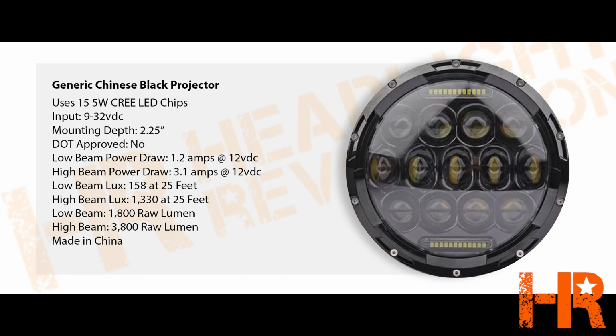It uses 15 5-watt Cree LED chips. This headlight has a 9 to 32 volt DC input rating and a mounting depth of only 2.25 inches. This headlight is not DOT approved. At low beam, it draws 1.2 amps of power at 12 volts DC, and on high beam, it draws 3.1 amps of power at 12 volts DC.